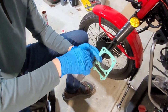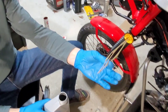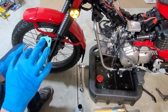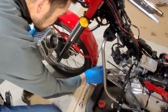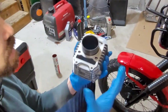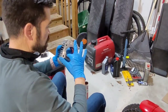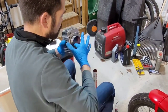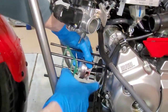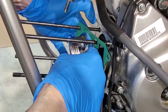Here's a little trick I found out after pulling off a couple of these top ends: if you put a little oil on this gasket, the green side actually faces the cylinder, and it's easily removed the next time. I'm just going to add a little bit of oil to it and place it temporarily where it goes until I remove the piece of plastic for the piston. On the inside of the cylinder, since it's dry, I'm going to add some grease so it doesn't start out dry, then wipe off any excess pushed out by the piston on its first time through. Make sure those two little alignment bosses are installed either on the engine itself or on the cylinder — if you forget those, you won't have a very good lineup.